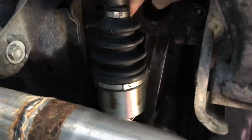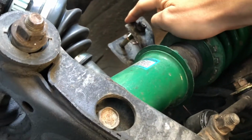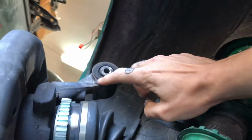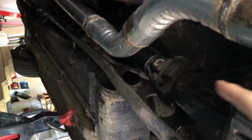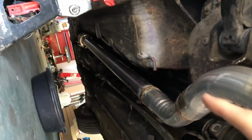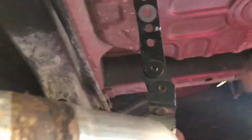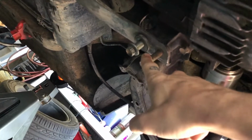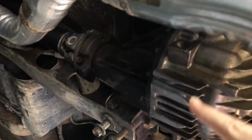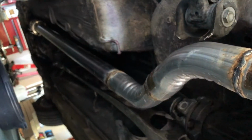You can see there's welding wire tied up. So that goes down and back to right here, and I use the nut for the top of the hub right there. You can see that's already kind of pulled out. So what happens is, first, I'll get the exhaust out of the way. I need to undo that V-band clamp right there, and then the exhaust comes out because there's no more hangers. The PPF is already unbolted. It's loose up there, and I just pull those off, and the PPF will swing out of the way because first I'm just going to get the diff out. I'll tackle the trans after that.